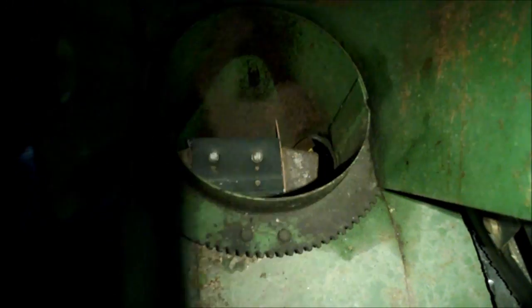I did it to a John Deere snowblower in here. You'll notice in this John Deere that I put a paddle in there, and it sticks up roughly three-eighths of an inch because that's how far off it was. A little thing like that is a quick easy fix and it makes a world of difference.